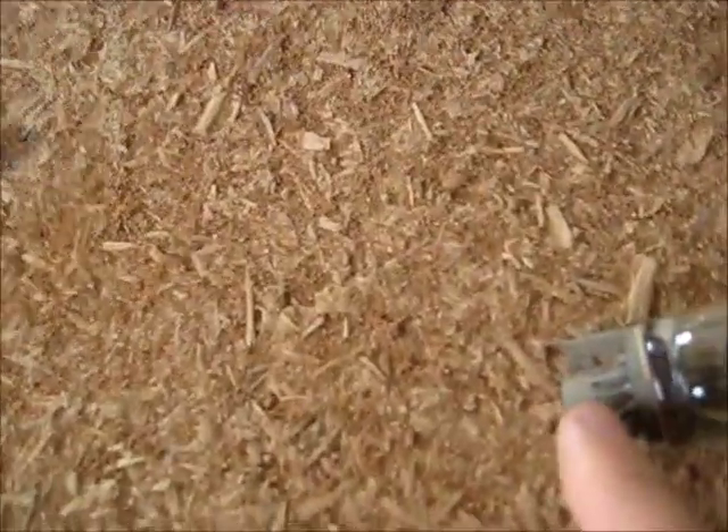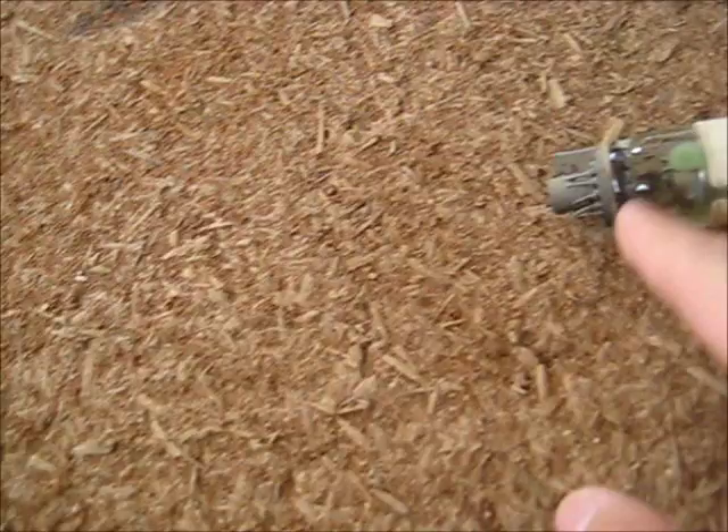I just had a look at the heater itself. Unless there's a blue projection CRT, they're pretty easy. You can see the two bits right in the middle there - that's right in the middle of the electron gun assembly, the actual heater, the filament. Look where the connections go to that and you trace that back. I've traced it back to these two pins which I've bent, and that's how I found out.